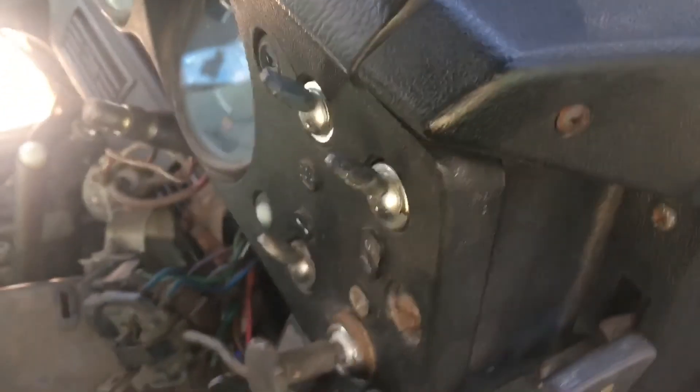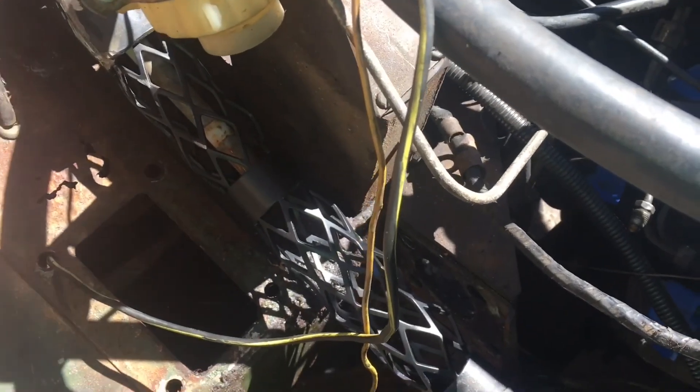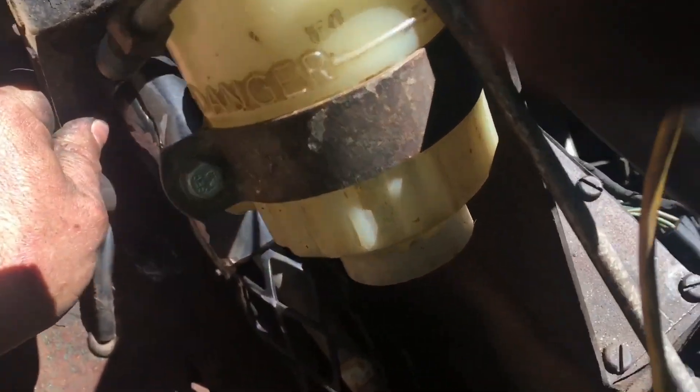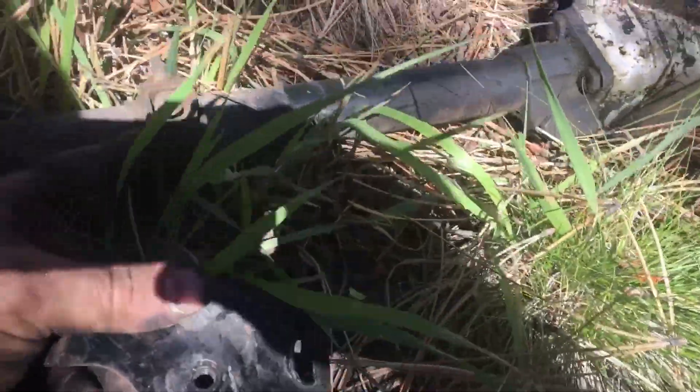We've removed all the unneeded parts off the Range Rover. The column is going to slide right up in here — a little difficult with one hand but pretty straightforward. We'll use the original brackets and mounting to get it nicely stable, double-checking that the hole radius is the same. I can see I'm a little tight, so I'm going to grind the radius out a little bit, make adjustments to the brackets as needed, and work on getting it up and in. I've got one bolt in up top — it's crude but it's in its correct placement.